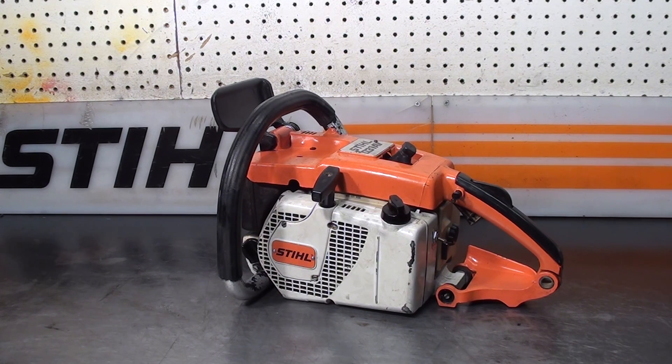We talked on the phone — it's got breaker points and they were bad, and there's a module you can put on there. In my previous video I show where to mount that module. And if you've got any questions on that or need one of those modules, feel free to call me. But this is the finished product here. We'll fire it up — it just runs beautiful with that module on it.